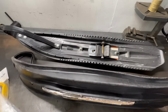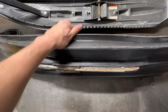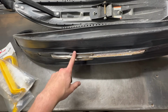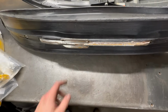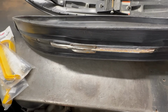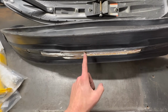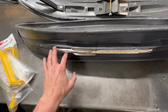Okie dokie. We got our usual SLP Mohawks here, running a stud boy shaper bar. And then these are the older ones, the SLP keel blade, they call it. We've always called it the spoon. If any of you are coming over from Yamaha stuff, back in the Apex days, a lot of guys did this same trick. My father and I have been doing this since, I don't even know, 2010 probably. Taking the keel blade, and they normally have a stud, and they're meant to run the stud up through here, and then a 2-post short bar, and then the keel blade centers on the next post, and you have nothing up front.